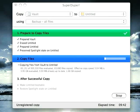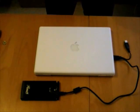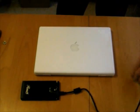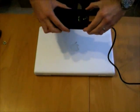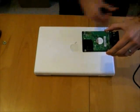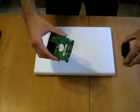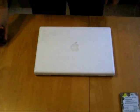As soon as it completes, we can install the drive inside the laptop. The clone is complete — it took about two hours and 41 minutes. I'm unplugging the enclosure; the laptop is now off. We just want to get the new hard drive that we've cloned all the data to out of the enclosure, separate it from the controller board. There it is — the 250 GB Western Digital hard drive that we're going to be installing.